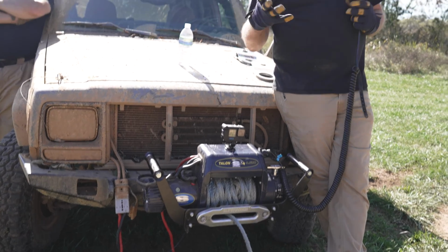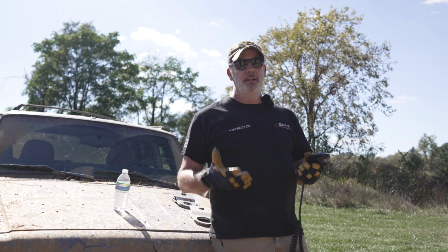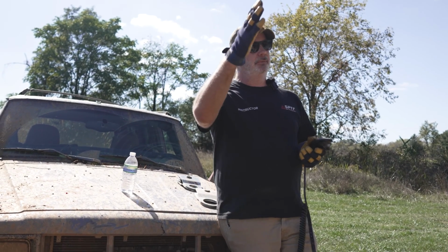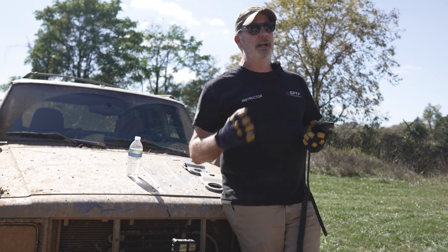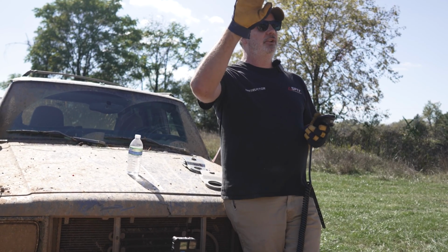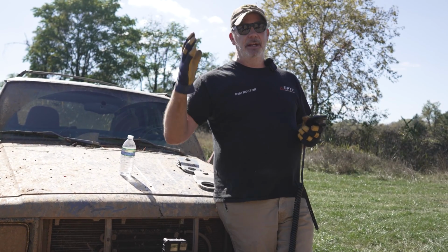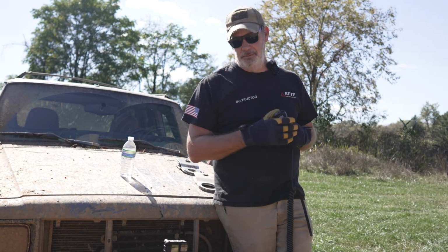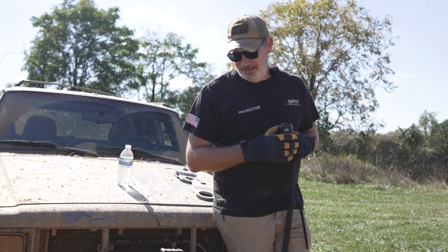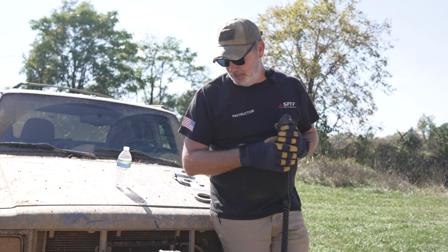Never, ever, ever be in neutral when you're winching. I get a lot of questions all the time. What gear should I be in? Be in the gear that you're moving. If you're going forward, be in drive. If you're going backwards, be in reverse. Never be in neutral. If I'm going up a hill in neutral and all of a sudden my winch line breaks or something happens, be in the gear you're going in. So never be in neutral. It's just not a good habit to have.